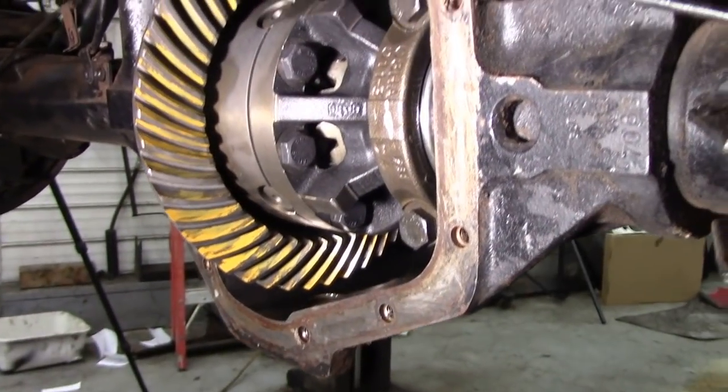But anyway, once I did that, I put the flanges, you know, the drive shafts back in with new drive shafts, new flanges, and it still clonked. And I know what's wrong with it. It's either the thrust washers or the gears in the carrier itself. There's a sun and planet wheels inside there, and it goes a bit like this. I wonder if I can move the camera and I'll let you listen. Perhaps this is a better view.